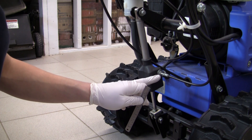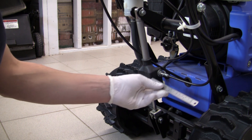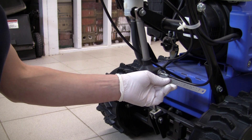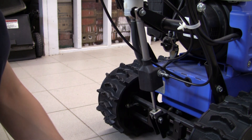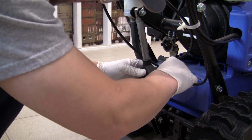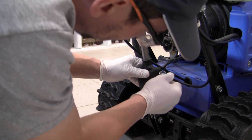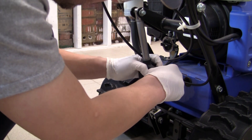So here we've got an adjustment nut that goes up to the handle — the adjustment nut for the cable that releases it. Now in the book it says the measurement between the nut and the shoulder is supposed to be 11 millimeters. I've got 12 and a half millimeters between this nut and this shoulder. So I've written that down and what I'm going to do now is loosen the nut and get this pulled back — that should loosen the whole thing right up and then we'll see how it's assembled.